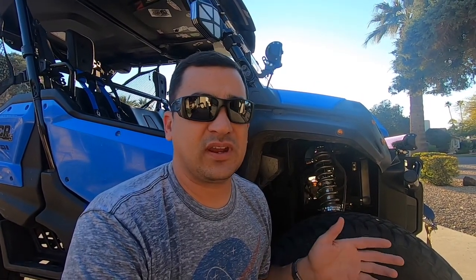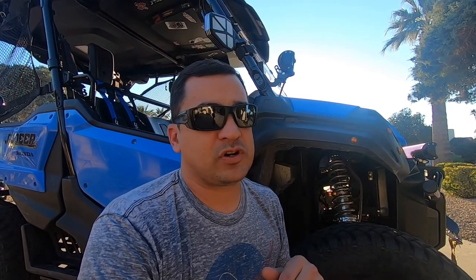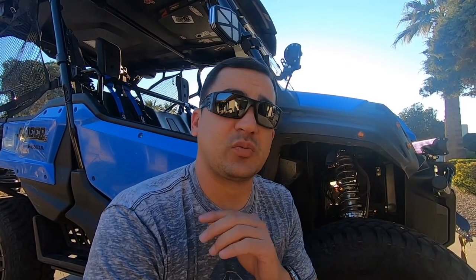It was okay. This time I had the Viking shocks, and now you do get a couple inches of lift. But wow, what a difference. I did screw up. I didn't run my rear sway bar, but you know what? I found I did pretty good, I think, keeping up with all the big boys. Not perfect by any means, but I did have to adjust the rebound in the rear so that the rear end wasn't hopping really bad. If you've got stock suspension, you should be fine.